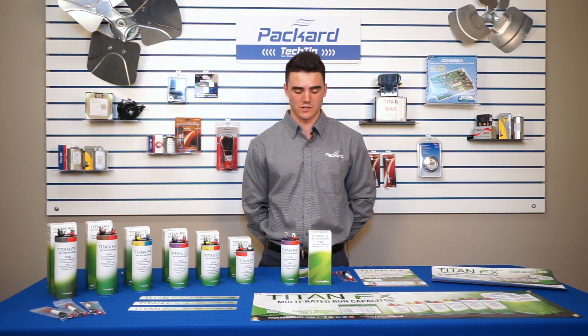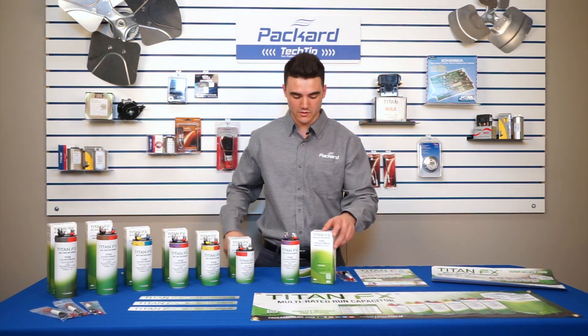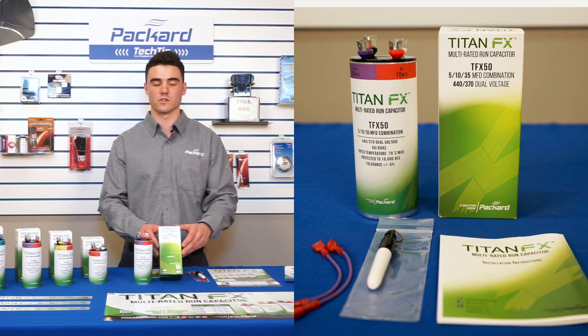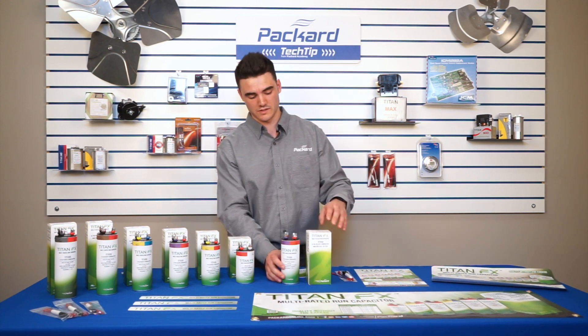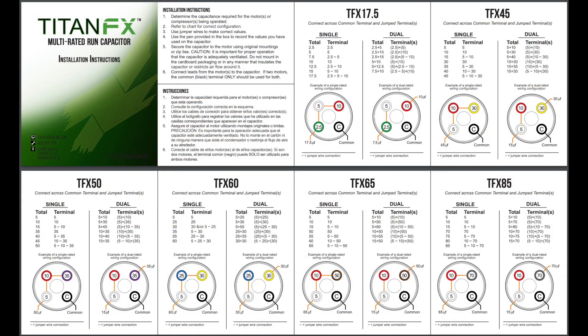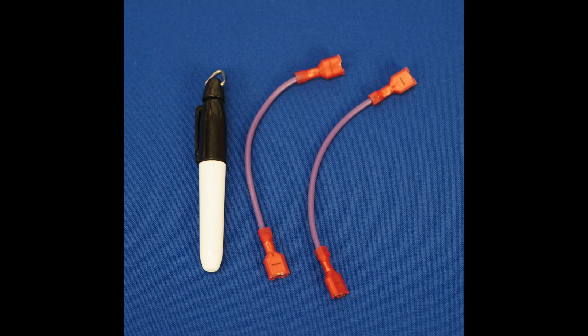Today we'll start by talking a little bit about what comes in the box. It is listed here on the box itself, showing that it comes with the capacitor, permanent marker, jumper cables, and the instruction booklet. Here's an example of our TFX 50. We have the instruction booklet here — you can identify the capacitance for your application whether it is a single or dual rated capacitor. From there you can look and see how to wire it with the diagram provided. Also included in the box are two jumper cables used to combine the capacitance based on your application, as well as a permanent marker to write down the final values being used.